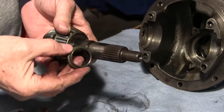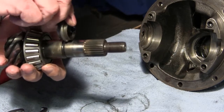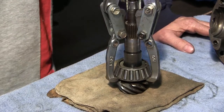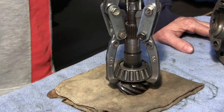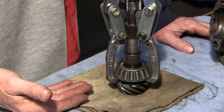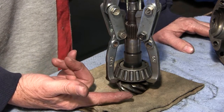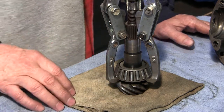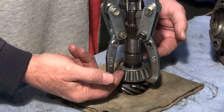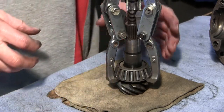It fits right here — this is where it was. The British tool would fit underneath the bearing race, up against the spacer — the pinion head spacer. I don't have such a tool, so I'm going to have to tear the cage off and then grab the race where the bearing sits and pull it off.